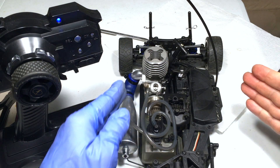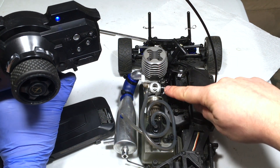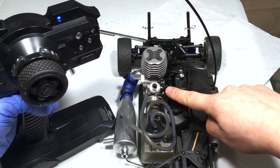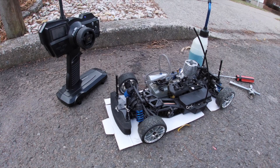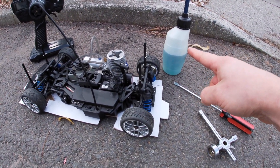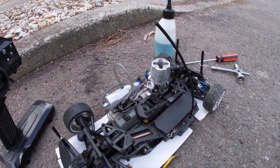You want a little bit of a gap between your clutch bell and spur. Everything is back on the chassis. This is the most important part — a final electronics check to make sure the car is opening the throttle normally. Under full throttle you can see it opening all the way. The brakes are functional. Here it is, guys — all fully assembled and ready to go.